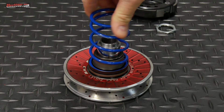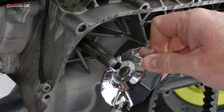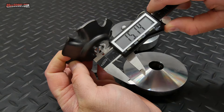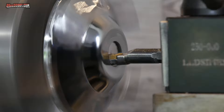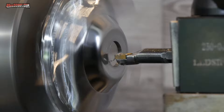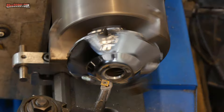I ran into another issue preparing to install the variator: the ramp plate that comes with this kit has a splined center, but the RC1's crank is not splined all the way down and needs a round center. I measured the ID at the outer peaks of the splined area at just over 14.8mm, and the Molossi ramp plate at about 15.14mm inside diameter. I thought it best to use the larger diameter like the Molossi since it worked well, so I chucked it in the lathe and cut it to that size. Without a lathe you could file or grind the splines out, but be very careful to keep the hole centered to avoid fit and vibration problems.